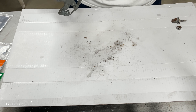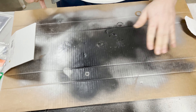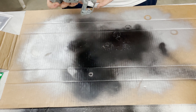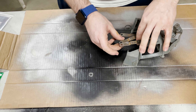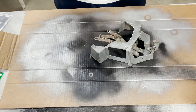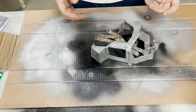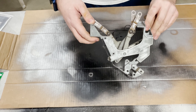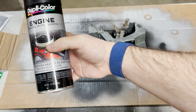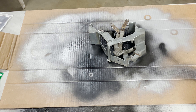Since I got all of this sanding dust and dirt on this piece of cardboard, I'm actually going to flip it over to do the painting. This is a piece of cardboard we use a lot for spray painting different parts. I'm going to start with this side, run through the paint with one coat, bring a heat gun out to get it kind of dried up so I can put a second coat on, let it dry, leave it overnight, and then come back tomorrow, flip it over, and do the other side. For this I'm going to use some Dupli-Color engine paint — this is a low gloss black. It doesn't have to be anything special since it's going to be hidden behind the gauge cluster anyway.